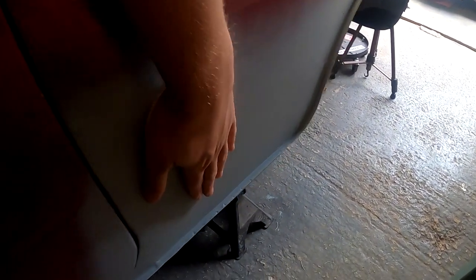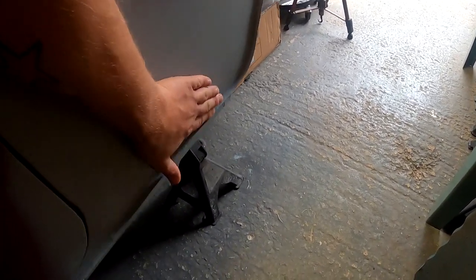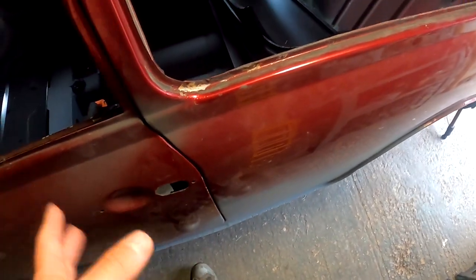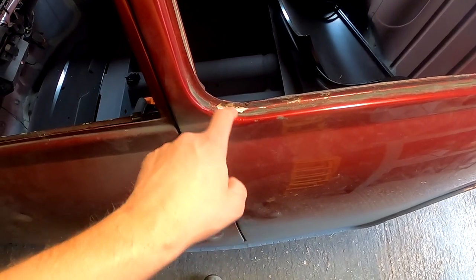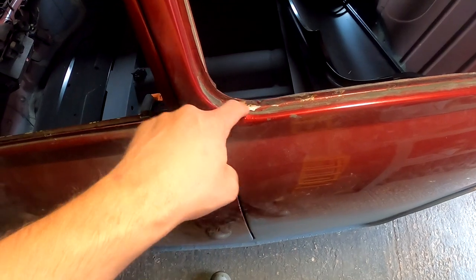It's not perfect — needs another skimp, but it's really not bad. There's a bit of a low spot there, but you remember we had this bit missing, the whole bottom missing. Inside it's obviously all painted and ready to go. Pretty happy at that. While I'm still here — there's a tiny little bit of bubbling. It doesn't even look like rust, it actually looks like a paint reaction. I can pick this paint off and there's actually no rust — it just comes back to primer.